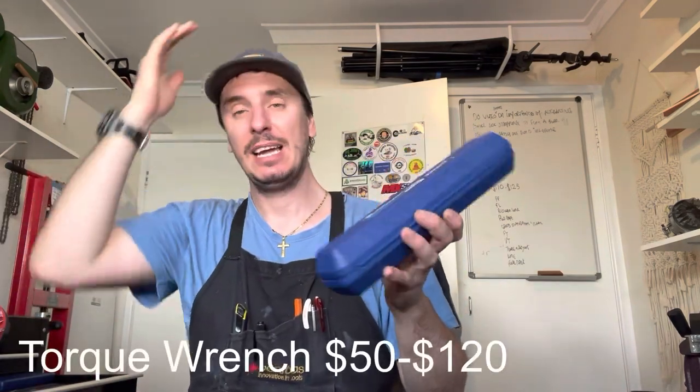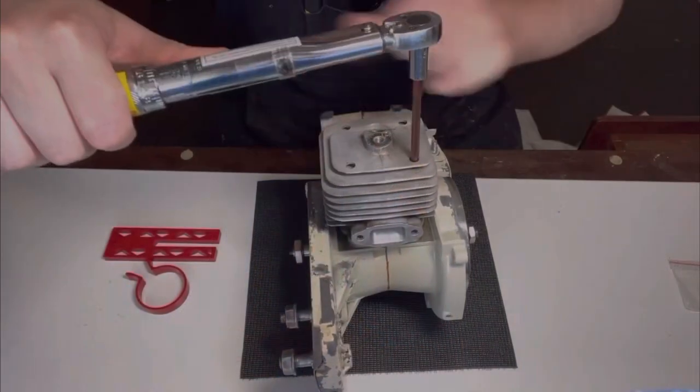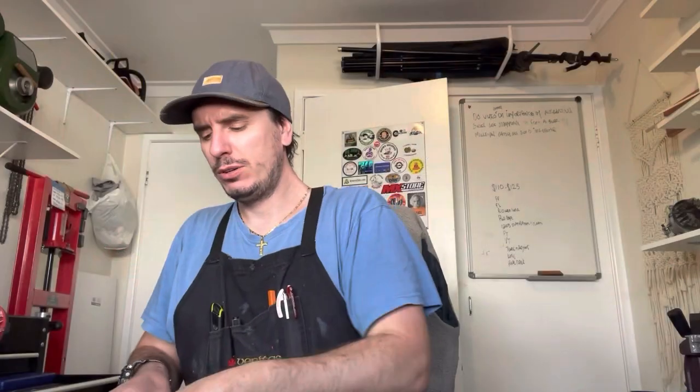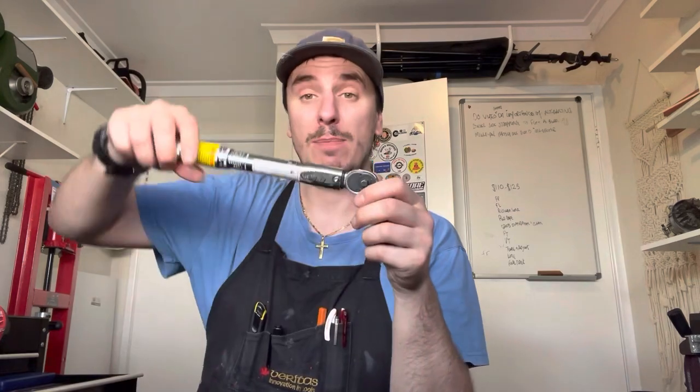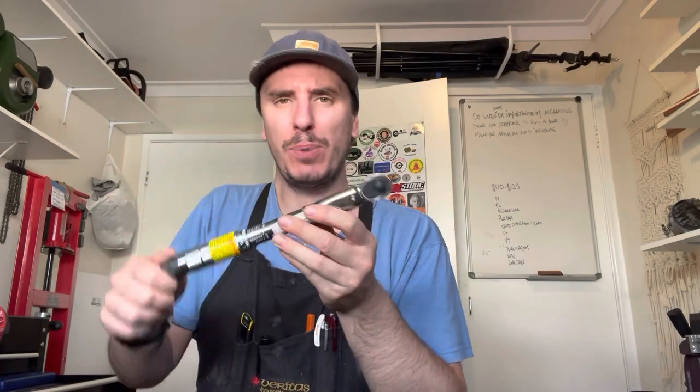Here are three tools that I think are probably a little bit overrated. First one — and this is going to probably irritate some people — a torque wrench. I actually think I've done more damage going to torque specifications than I have doing things by hand with a ratchet or T-handle. You can't feel with so much leverage how that nut, bolt, or screw — especially on light torque specifications — is actually responding with those threads. Every time we take bolts in and out we weaken those threads, and that torque spec can then no longer reach where it should be. I think they're overrated for small engines.